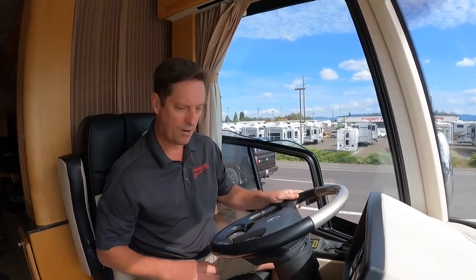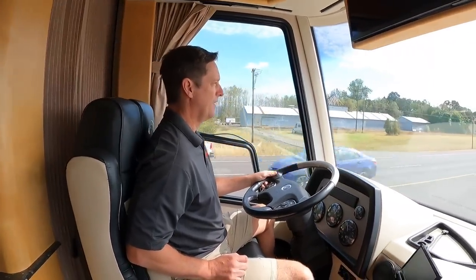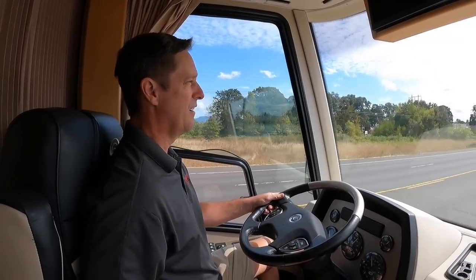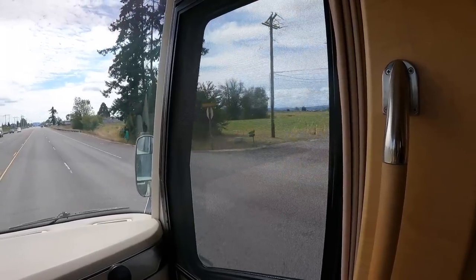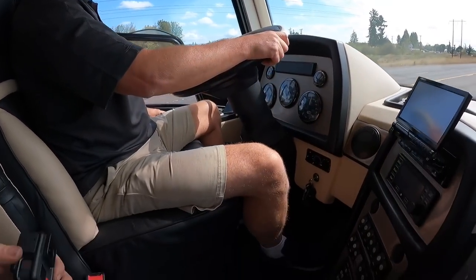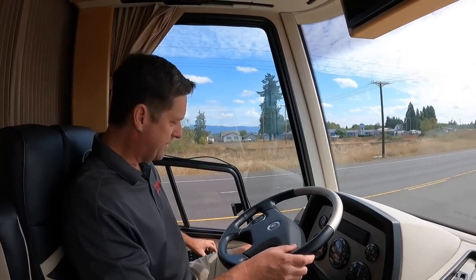What I really like about this is the power — the takeoff. Everything about this engine — we're definitely feeling the acceleration, it's no joke. We're up to 45 here quickly, not a lot of steering effort. These coaches you kind of effortlessly steer — two fingers and you're straight down the highway. It's a really comfortable feel. We're going down the highway close to 55 miles an hour. This has a three-stage jake brake — I'm not even going to use the regular brakes. I just dial down to low and it almost gets us down to zero.